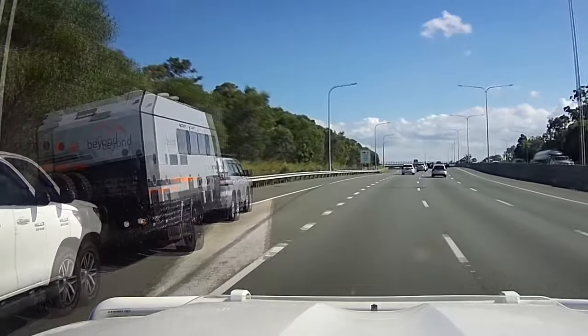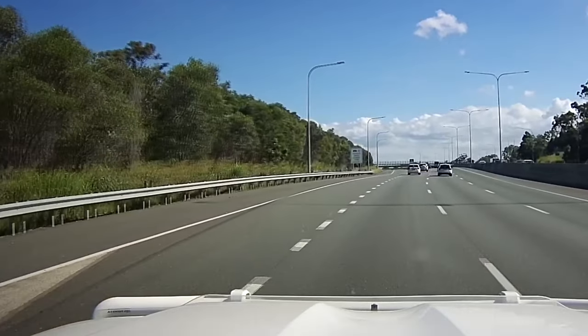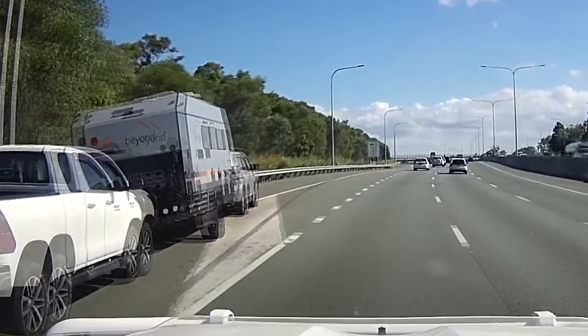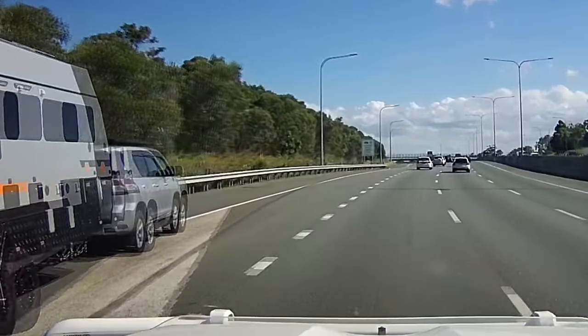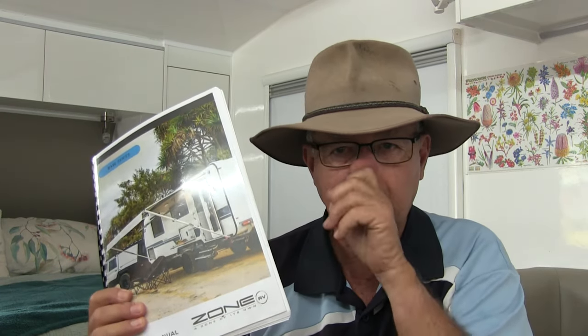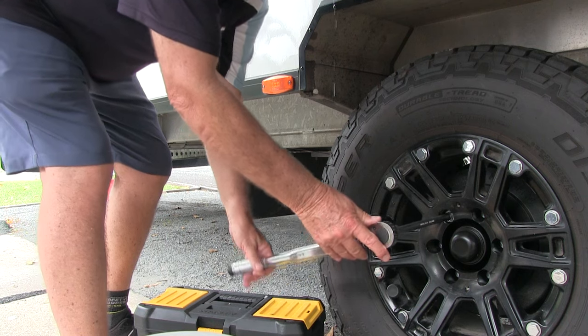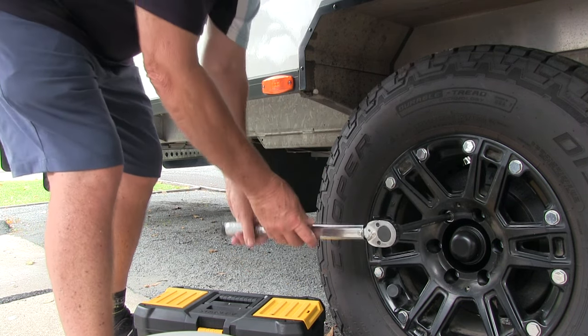Here it is again in the replay — we've captured both of these on dash cam. I don't know the circumstances why those wheels came off, but you can certainly see what happens if they do. On a single axle trailer it's quite a disaster and hard to recover from without assistance. In the owner's manual — and I'm thinking that most caravans do come with an owner's manual — it does tell you to check the wheel nuts and make sure the torque tension is correct.